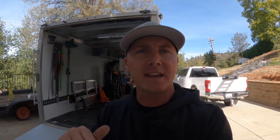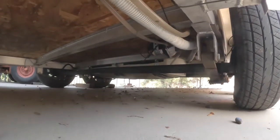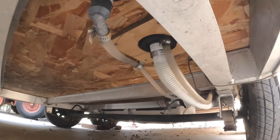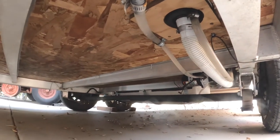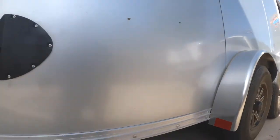For my pressure washer, I put in a 35-gallon tank and mounted it between the axles with metal straps, using some foam in between. I wired in a 12-volt pump to the electrical panel that runs off the battery — worked out really nice. I used to have a gravity-fed tank inside that took up space; now I just turn it on and it pumps out 35 gallons. With the Craftsman pressure washer I can wash five or six bikes depending on how muddy they are.